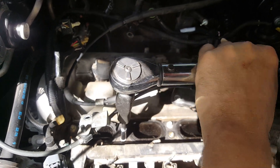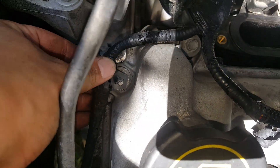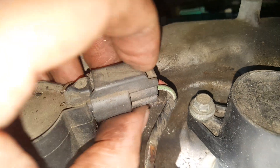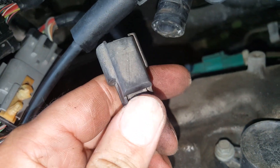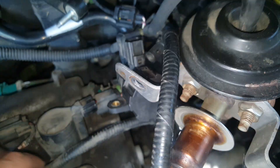We've got all of our lower intakes set under there - it wasn't very difficult at all. We scraped that down with a putty knife and used a wet vac to vacuum up any debris in there. Now I'm getting ready to set this back into place. We're getting our bolts back in and lining this up - you can see down in there to where you need to move it. We'll get them all lined up and started by hand before we go to tighten anything.